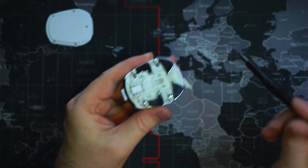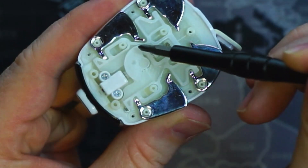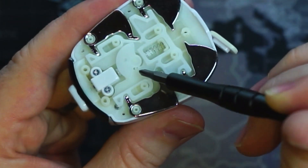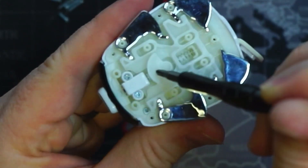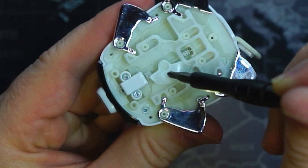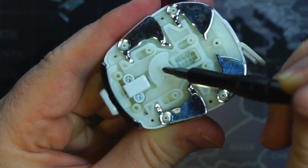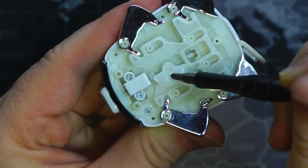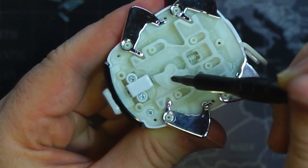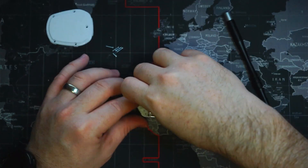You can see the mechanism here — the motor turns some teeth on the outside of this. There's this one-third-of-a-circle piece here, and on the inside of the circle there's a gear that catches the teeth on the inside of this mechanism. So when that turns, they open up. I'm going to move it over one or two gears because the mechanism almost runs off the gear teeth for the motor.